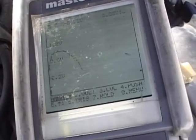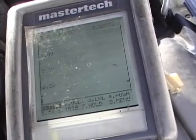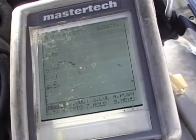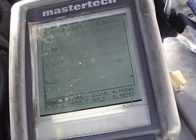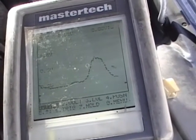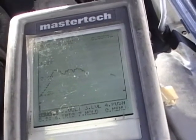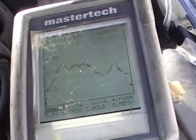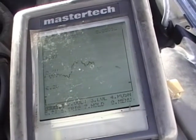This particular car was not throwing an oxygen sensor code. It's an OBD1 car — they're not quite as sensitive. If this were an OBD2 vehicle, it would have thrown an oxygen sensor code the way it was. But just a good example in this car. This car still gets 30 miles a gallon in the city with the old oxygen sensor, so hopefully I'll improve it now.